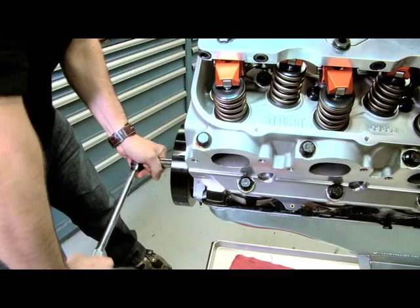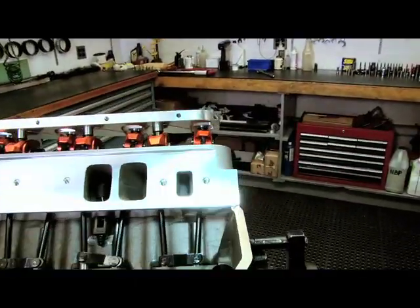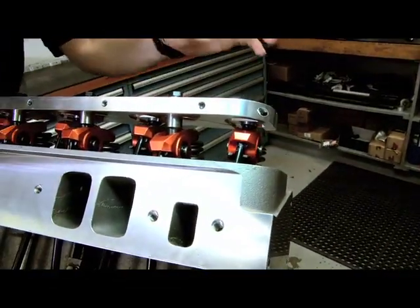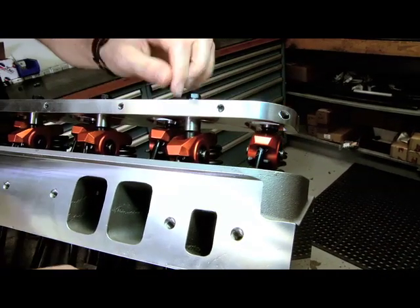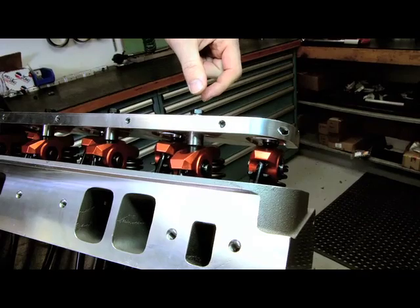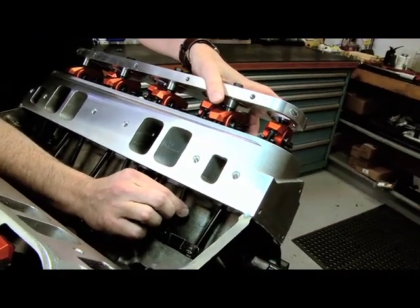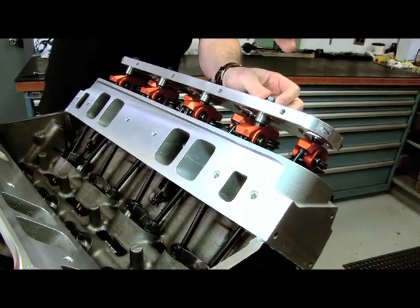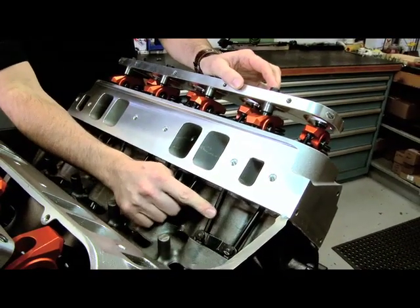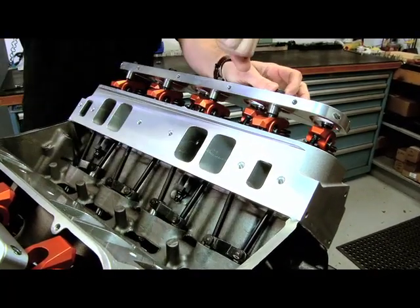So I can go about 90 degrees and I'll be TDC on number eight. So if I come up here to number eight, I can set both of these. Now if I've got hydraulic, what I want to do is start tightening this down and I want to feel my push rod. Just when all the lash goes to zero and I feel a little tension there, then I can give it another half to three-quarters of a turn. Now I've got my push rod and everything in my hydraulic circuit just enough. Everything is set right. I can lock it down.